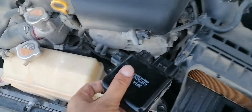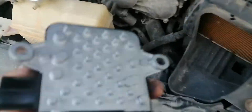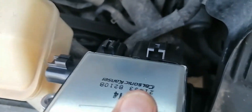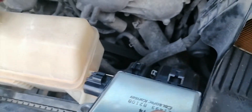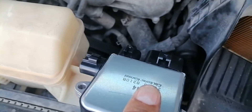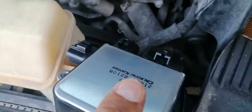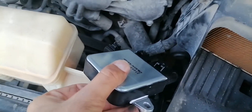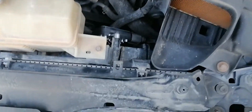There it is — this is the faulty one. I just disconnected it and I'm going to replace it with this new shiny one. First, connect the connectors, then see if the fan stops turning. The aim is not just to stop the fan — it's to make it run whenever it's required, not all the time. I'm going to hook up those connectors, install it in the right place.